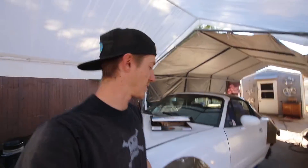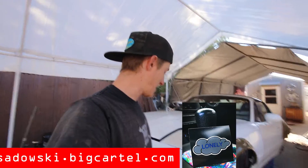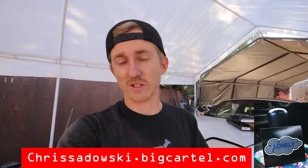I already run their Super Miata coolant reroute and it's fantastic, so I went with them. The other choice was Flying Miata, but I heard theirs is hit or miss — a lot of people love them but a lot have issues, and they're more expensive. Super Miata really tests their stuff. We've got Doge helping out because transmissions are heavy and I'm tired from the bushings. Transmissions on these aren't that hard — drain the trans, power plant frame, driveshaft, starter, take the slave off, unbolt the housing, drop it. Let's get started.